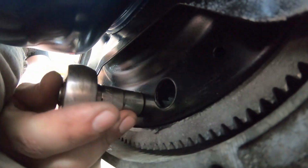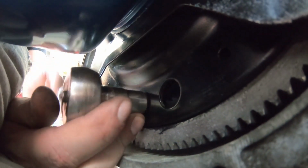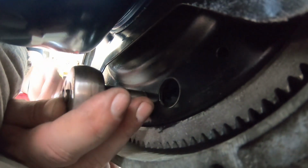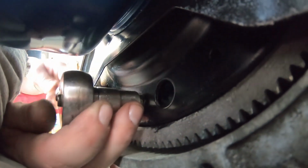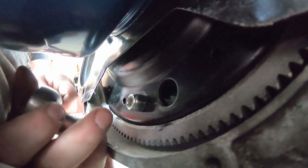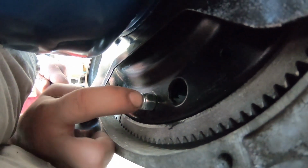You normally don't really use a nylock. This is really unusual with the ProComp converter. You know, the Ford ones are like an actual proper converter lock nut. And if they're not a lock nut and they're just a fine thread, they come with a spring washer. Oh, it's a bit closer. It's a bit closer, yeah. The threads are just there. Not too bad.